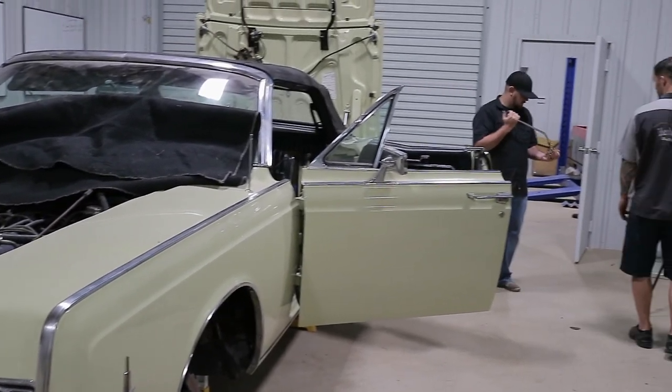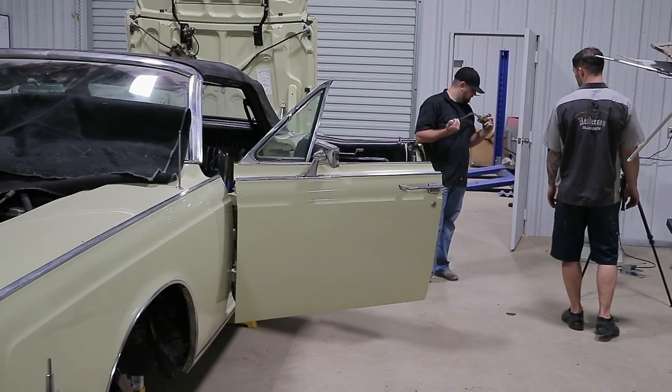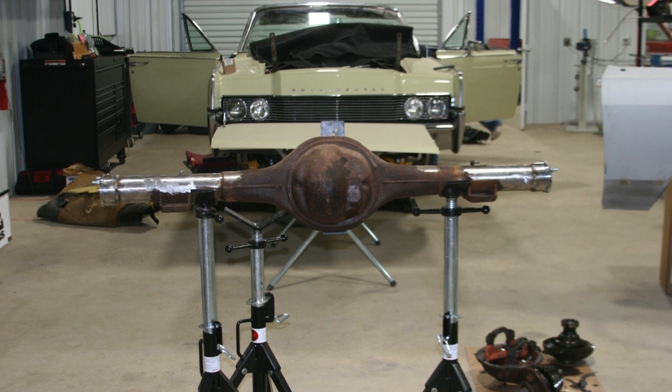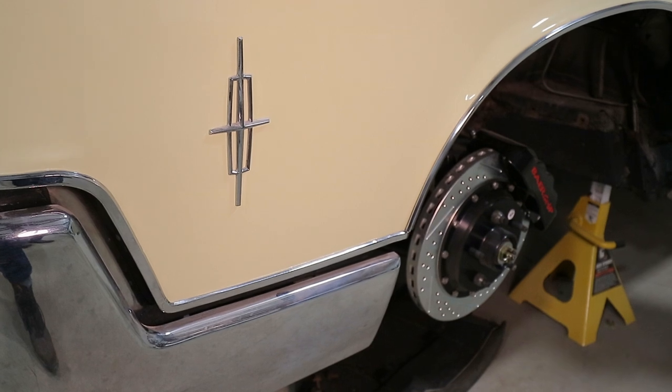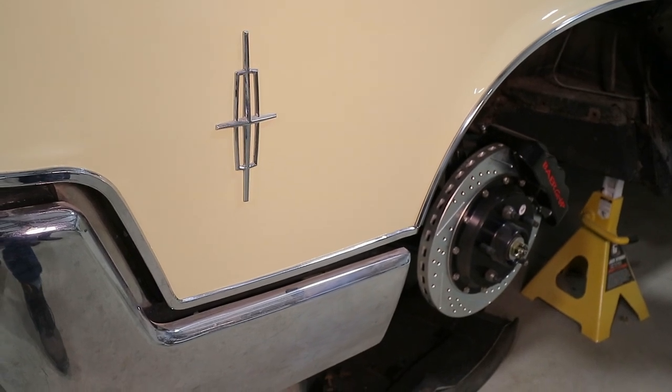We're actually narrowing the rear end on this car two inches, so the wheels will sit inside the car inside the fender wells. We didn't want to tub the car — we didn't want to take the inner fender wells, cut them out, and tub them. That's not the look we're going for. But when we talk about stance, that's just going to be a subtle thing — you're going to see the way those tires and wheels sit inside those fender wells. They're going to set it off, and it's not anything you'd know exactly what we did just by looking at the car. You just know there's something different there. You just love the way it sits.